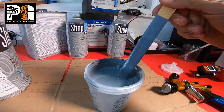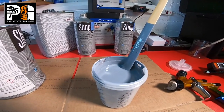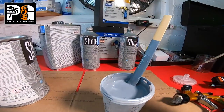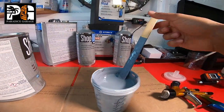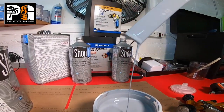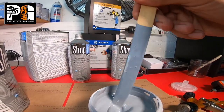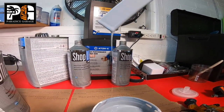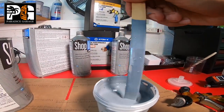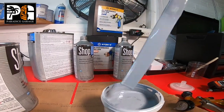on how to gauge thickness and how to look for thickness. It's important to do this, even if you're a newbie, because you start to learn the paint and to see how it drips. So it's super important. My dad taught me this when I was 13 years old, when I first started painting: while you're mixing the paint, if it's too thick, it'll literally gum up at the end of the stick here, but it's dripping really nicely. Kind of like a 1, 2, 3. 1, 2. This is actually thinned out really well for a thinned out primer, whether it's epoxy or filler.